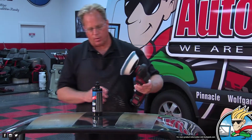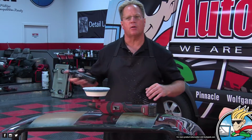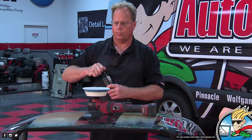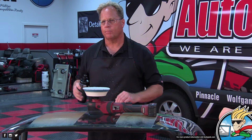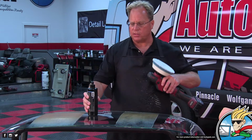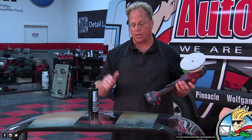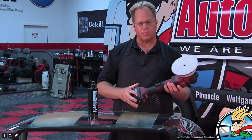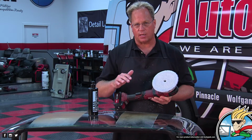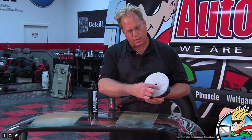Okay, so then what I want to do is go ahead and shake this up, and I'm just going to polish right down the center here, and then we'll wipe off and take a look. So basically the reason why you're shaking is because a lot of the abrasives would probably settle? Yeah, settle out. Right. And you know, Yancy, we teach the technique called picking a bead up, using the 10 at 10 technique. Yep. And I'll do both, but here's something I like to show people: if you're uncomfortable using the 10 at 10 technique and you're using a rotary, you can just put the product on the pad, but put it around the center.